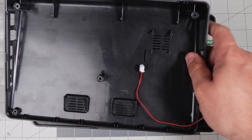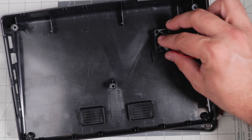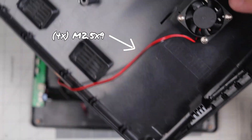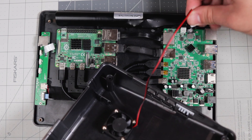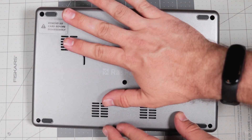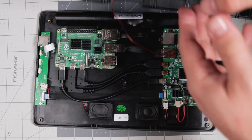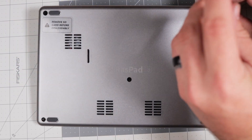Finally, install the fan with the label side down so the fan is exhausting out of the case. Grab the M2.5x9 screws and put all four of them into the bosses to securely connect it, then connect the fan header to the main board — it can only go in one direction. Before putting the back on, make sure no cables pass over the center screw; there are two molded holders to keep cables out of that area. Snap the back on and put the five screws back in — assembly is finished.